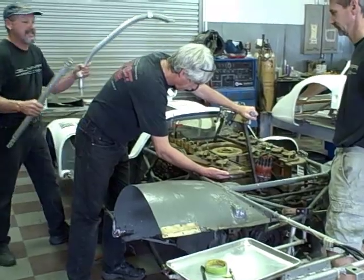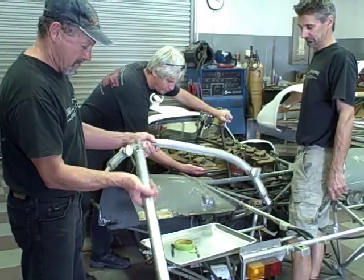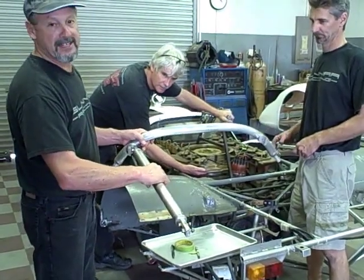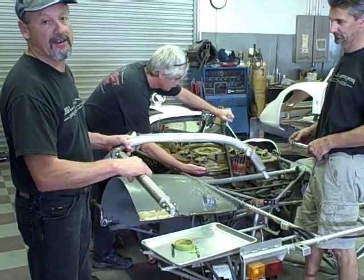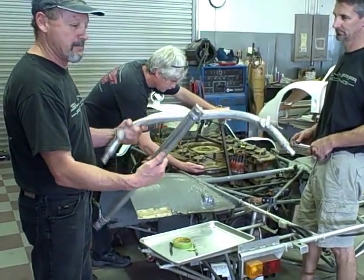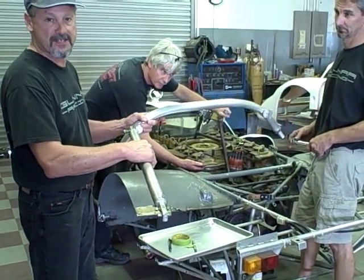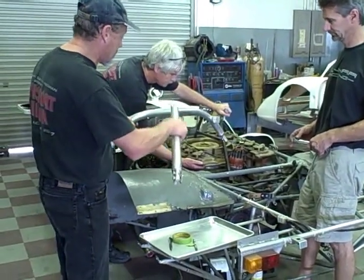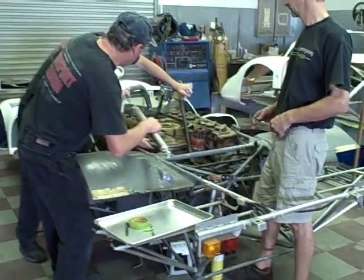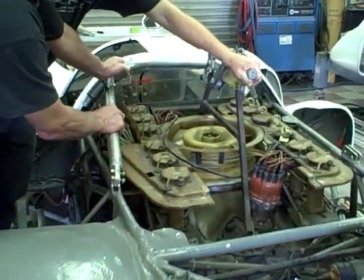There are things that have to come apart to get it out. This very light aluminum roll bar — there's another leg missing — is the update for 1971. The car didn't have a roll bar; it just had a little bar to hold the roof up. The FIA mandated a real roll bar for '71, so you either put the bar on yourself or send it back to Porsche. It comes out in three pieces, but Andy's holding up this side of the motor so it doesn't tilt over. It just gets bolted in with eight-millimeter bolts.